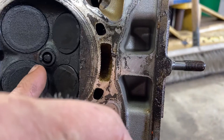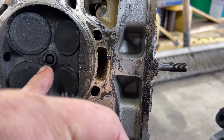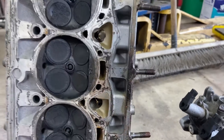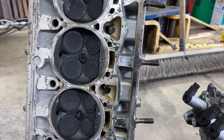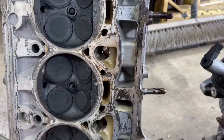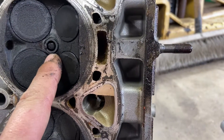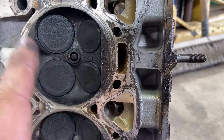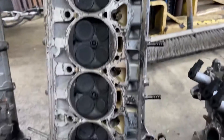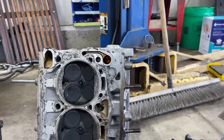That's another example of why it's a good idea not to wait forever to change your spark plugs. Change your spark plugs probably every 25,000–30,000 miles if you have really good ones. Don't cheap out on spark plugs — they're so cheap. Get the best spark plugs you can get: Bosch or NGK, the higher levels, because you don't want your electrode to blow off from neglect and that little piece float around inside your cylinder until it finds its way out the exhaust.